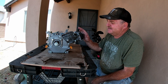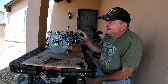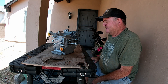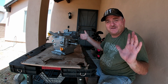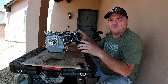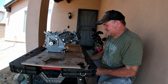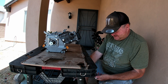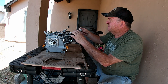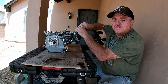So we're going to pick up where we left off and take the rest of the engine apart, get to the inside so we can take out the governor and start installing the rod and the other billet parts. I know it might be kind of dark - I'm trying to work in the shade a little bit. It's really hot outside. So I'm going to go ahead and get the valve cover off. That's an 8mm and I got my tools hopefully handy right here.